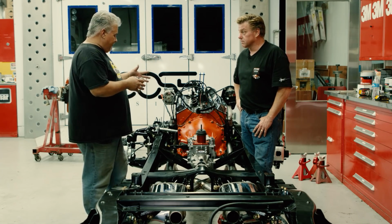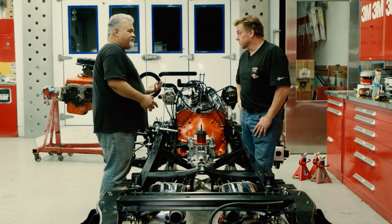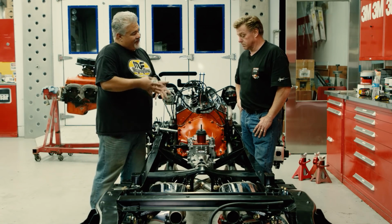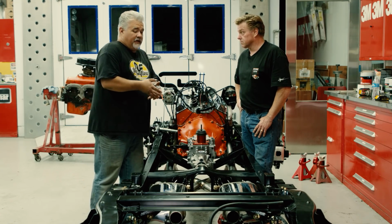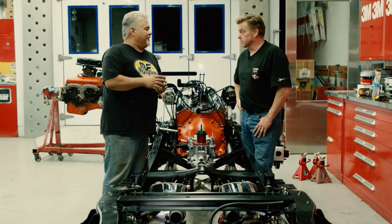So here we have our crossmember back, which gets you right here from the bell housing and works from that crossmember all the way back as a bolt-on part. And then the front section is what we fabricated earlier, and we always have to fabricate that based upon the engine and manifold or header configurations that are out there. So 2.5 mandrel bent. Big plus is the X pipe, gives it that balanced sound, a little bit more modern, makes a little extra torque. The bigger mufflers for the truck, so if you are carrying some load in a trailer, you definitely have something that's going to sound good and give you a performance note, yet at the same time knock off some of that drone and the low frequency vibration in the cab.